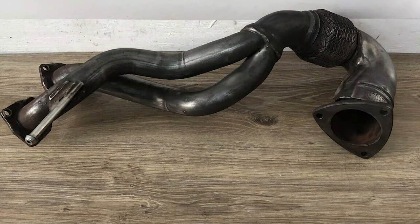And then on the exhaust side of things, you currently have a downpipe, which is one piece, which then goes into two smaller pipes, which does have quite a bit of restriction compared to, say, a 3-inch single downpipe, because the air doesn't have to break up into two pipes, which are a lot narrower. Admittedly, you can add the diameter of the two pipes together, which will then give you an increased diameter, but it won't be the 3-inch, so it is a massive restriction.